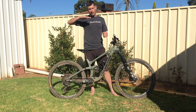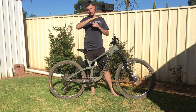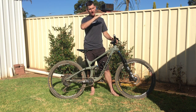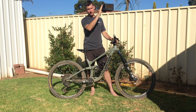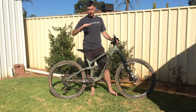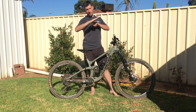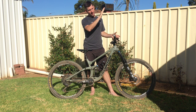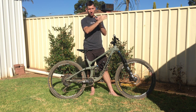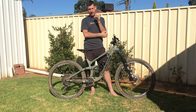So the 0.4 is a little bit firmer at the start, and then same story - hits a wall, but the wall's not quite as abrupt, so instead of a vertical wall, it's more like a slope. And then the 0.2 spacer, it starts a little more rampy at the start again, and then it ramps up into a bit of a wall. Not too bad, it's not really a wall, but I was finding I had to run it too soft at the start for it to not be choppy in the deep, repetitive, hard, high-speed hits.